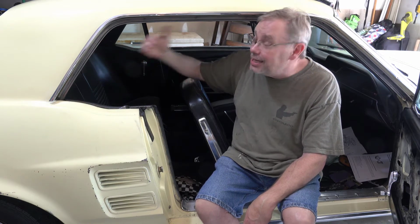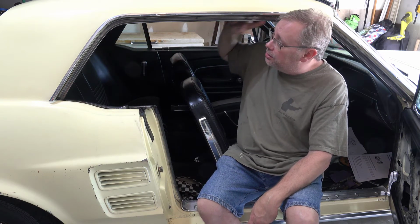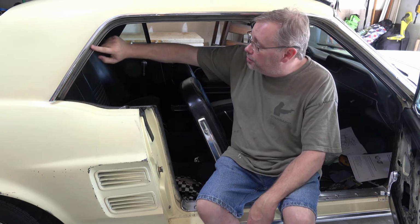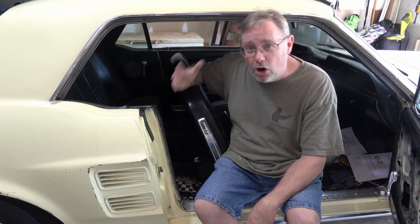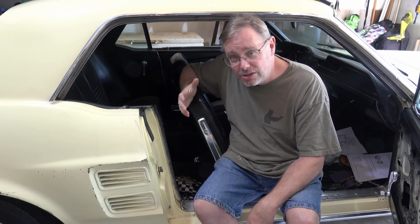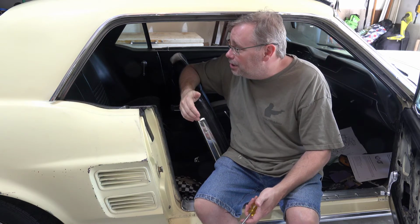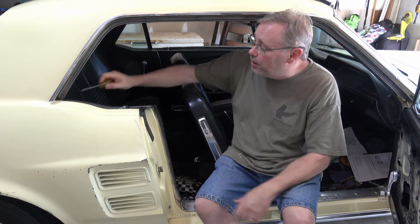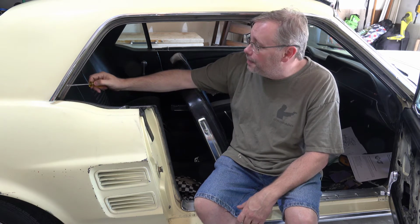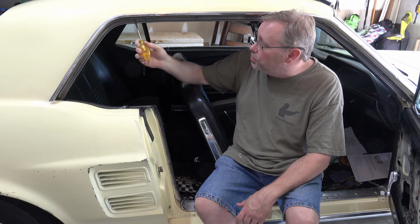And then this morning I came back with just some rubbing alcohol and cleaned the channel once more, both the lip over here and the one over here and in the middle. I did the same thing on the new weather stripping itself, just to get any oils and things off. So I'm going to put in a little bit of the weather strip adhesive. I'm going to probably start some down here, then some up around this corner here to make sure it holds in place.